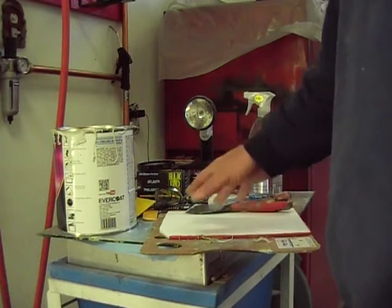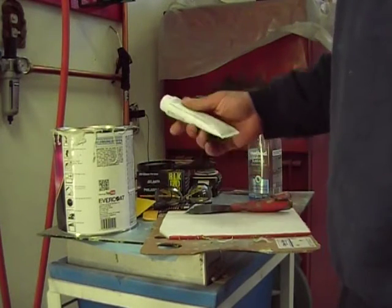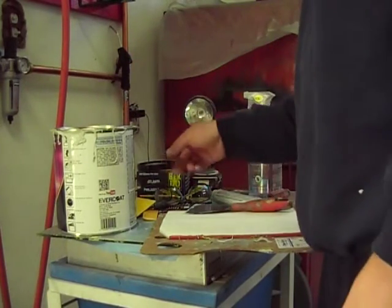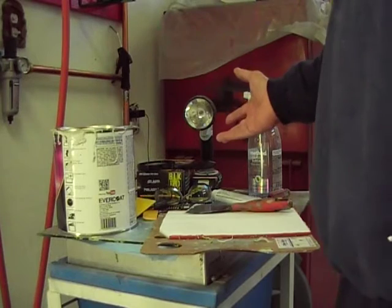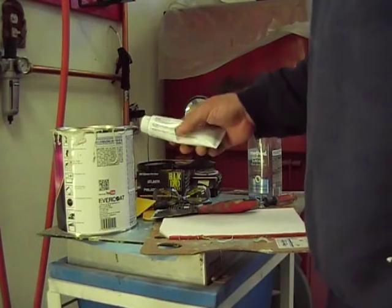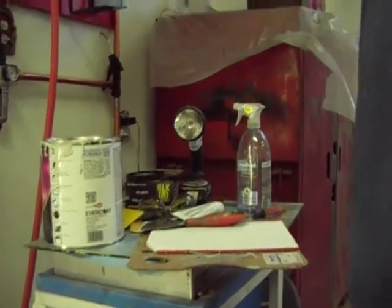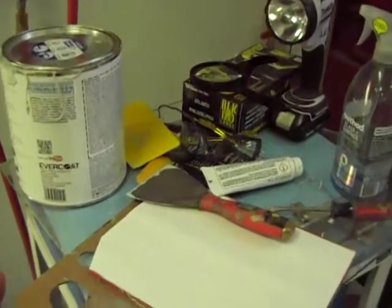Well, I got online and was looking. Another thing that causes pinholes, at least what I'm seeing on the forums, is if you use too much hardener, which I don't see how that's possible when you have this. I mean, literally, I have a tape measure that I had over here. I measured out my 4-inch circle, so I'm assuming everything should have been just like it's supposed to be. Well, the only other thing that causes pinholes is putting too much hardener in it. So maybe I put too much hardener in this filler, or I didn't mix it up as well as I needed to and it got too much hardener in certain areas. But the thing is, I mixed that up until it became a uniform blue color. So that's the way you do that too.